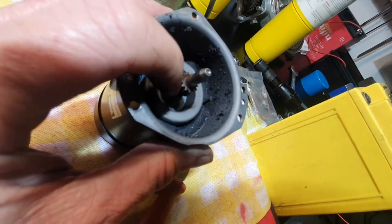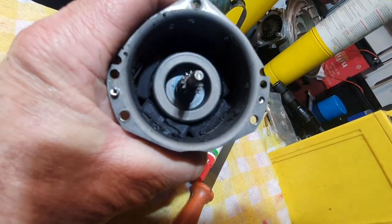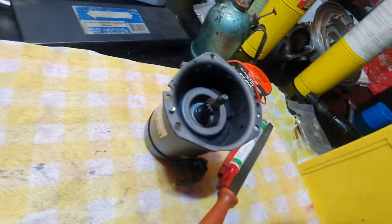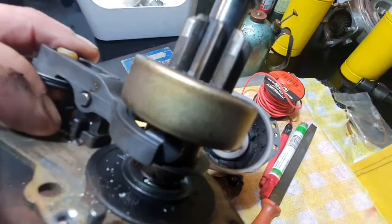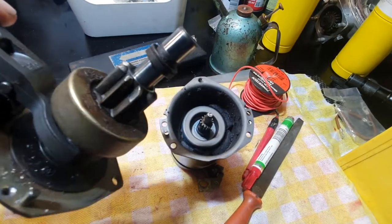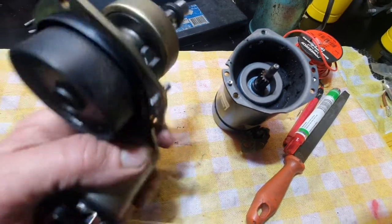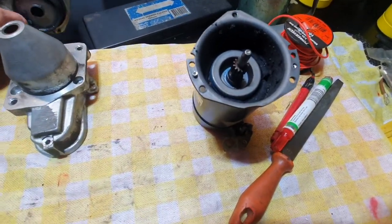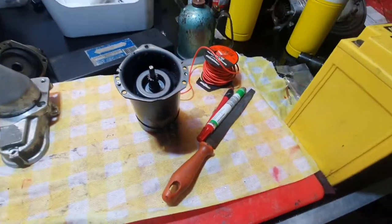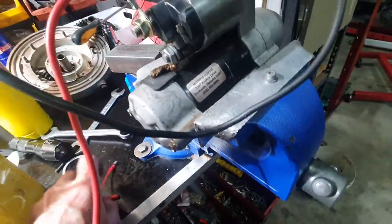This is the centre gear that goes into the middle of the epicyclic gearbox, and that starter motor is done. The nose on the front isn't too bad — that's the epicyclic gearbox, the sprag clutch, and the Bendix gear there. They actually work fine; there's nothing wrong with them. The solenoid's working too, but the motor itself has collapsed. You can buy replacement motors for them, though I haven't.